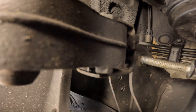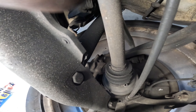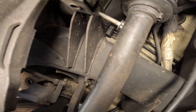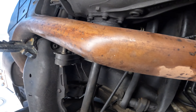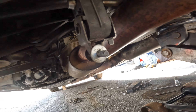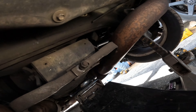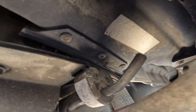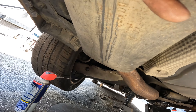Let's take a moment to marvel at this German engineering where this bolt is too long and actually hitting the axle shaft, so I can't get it out. All they had to do was put that bolt in from the other side and put a nut on it. With a little bit of persuasion I got it out - I had to lift this up and shake it around. Going to try installing it the opposite way now.